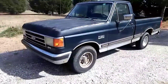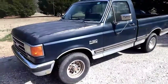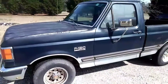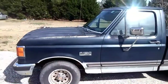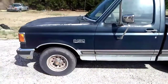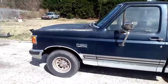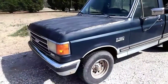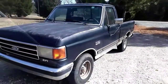All right, before you drive off, sit down, pump the brakes a few times. This one here wasn't real light when I push it the first time or the second time. Some vehicles, it'll just hit the floor all the way. Probably after the second or third, that means you got fluid back inside the caliper. And this one here was pretty good. Took it for a test drive, run real nice, no more noise. I actually feel like it's not holding back. It just rolls, which is good.